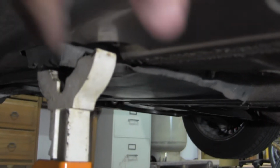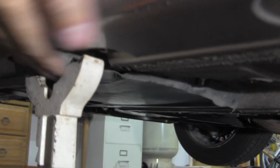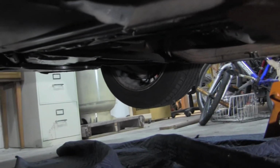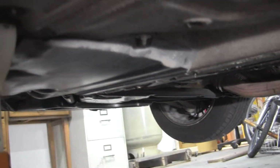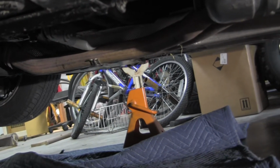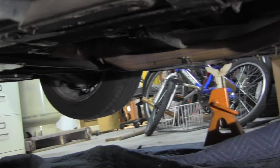So we wanted to end up with these jack stands on these jacking points, and so we couldn't lift from here. So we found way up under, we could reach this frame rail is where we ended up lifting the car up. We lifted it here and then supported it by the jack stand on the jacking point and did the same for the other side. So we got this car now safely lifted. We'll be able to remove the wheels and see what the next progress is.